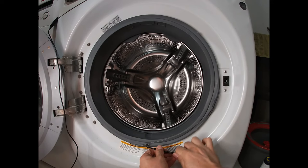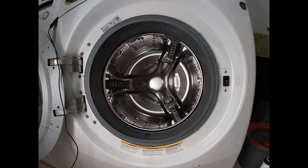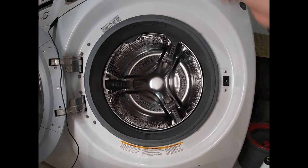Just be careful that you don't slip and hurt yourself. Double-check that the wire is seated all the way around properly. Then you can wipe the inside of the gasket, give it a test run before putting any laundry in, and make sure it's not leaking. This will stop the leaking down the front and also make sure there's no mold buildup or smell. Thanks for watching — please like and subscribe.